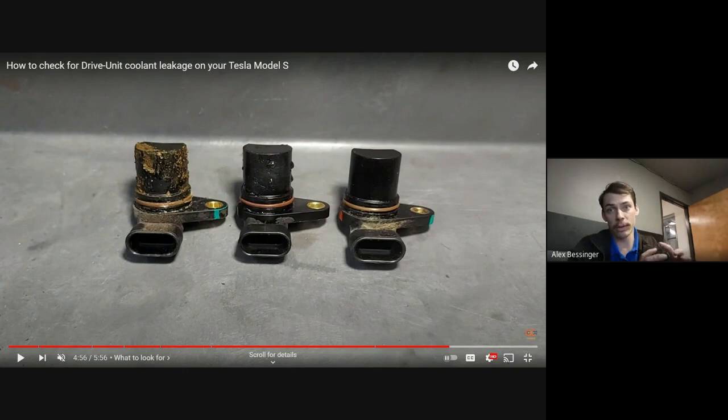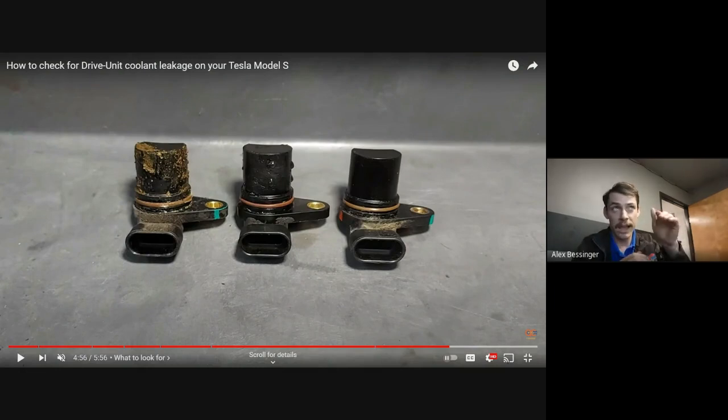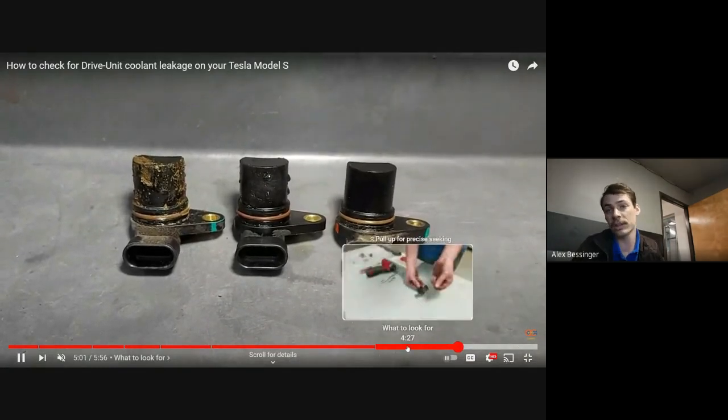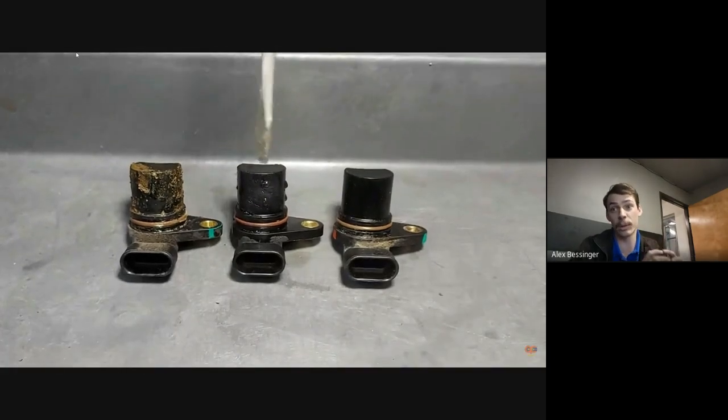That's the part of the motor that has all the windings, and it's all encased in a sort of plasticized resin. The coolant can soak into that resin and cause corrosion of the windings themselves, the copper windings. Oh, wow. It can also cause rust on the outside surface of the rotor, and there's steel bars in the windings as well that poke out through that resin. So it can do a few things. It can cause a loss of high voltage isolation between the stator and the case. And it can also cause that rust buildup on the rotor and the steel bars in the stator, which can actually seize the motor up solid. Because, of course, as rust forms, it expands, so it literally squeezes the rotor into place.